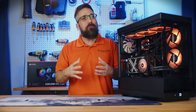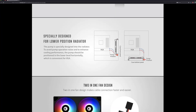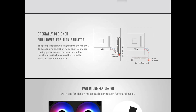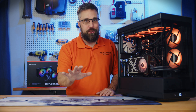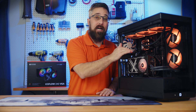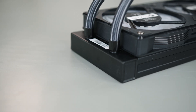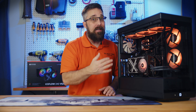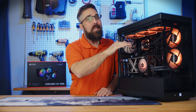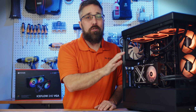With that I could call this an absolutely perfect product. Unfortunately, there's a huge discrepancy in the product description and instructions. ID Cooling clearly shows and describes the pump as being located in the radiator, and because of that says you can install the radiator at the bottom of the case under the GPU — but it's not, and you absolutely shouldn't. The pump is very obviously in the pump block installed on the GPU, just like a normal AIO. The pump power cable goes into the pump block; there is no power going into the radiator and no pump in the radiator. Therefore, if you install the radiator below the GPU, the pump will be the absolute highest point in the loop — and as everyone familiar with the Gamers Nexus video knows, pump on top is worst case. All the air in the loop will rise to the pump, and the pump will fail. So regardless of what the directions say, don't do that.